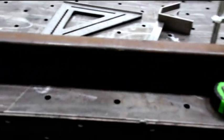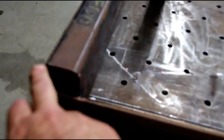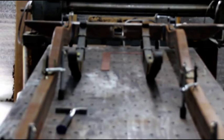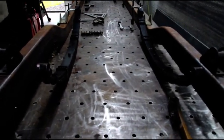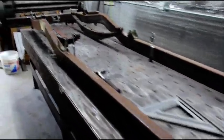Frame dimensions are the most critical thing here. I'm keeping this kind of stock, kind of custom, but maintaining the 29 and a quarter width — outside edge to outside edge, 29 and a quarter. I've got the rear cross member on already and I'm working on the spring location. There's a lot to figure out to fit a large Cummins 4BT in here.